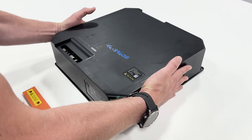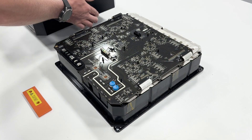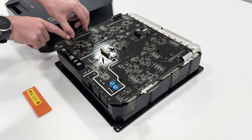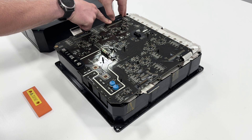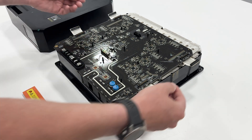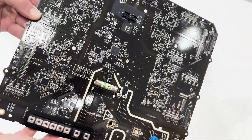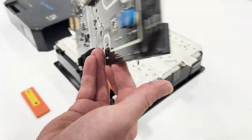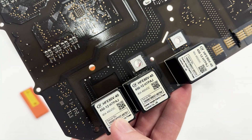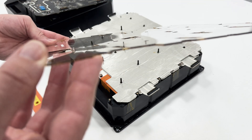This is a battery module pretending to be an entire battery pack. It's 400 volts and has everything a battery pack has. It has a master BMS as well as a satellite BMS, all on that big PCB. The things I'm unplugging are actually the data lines from the cells below - that's the 3.4 volts coming up from the cells that the battery management system uses to balance and keep them all in check. Looking closer you have pre-charge, a pre-charge fuse, positive, negative, 12 volt, CAN and HV out on that board. On the back you have a positive contactor, a pre-charge contactor and a negative contactor. It's all gold - so a rather expensive PCB with an awful lot going on but very well designed.